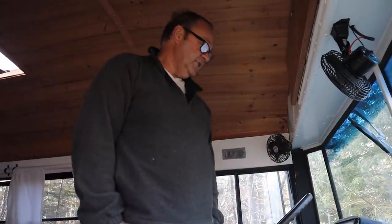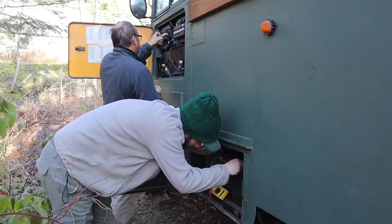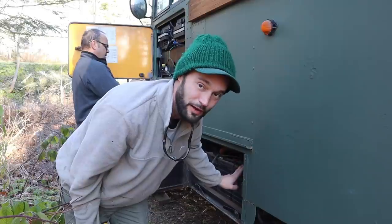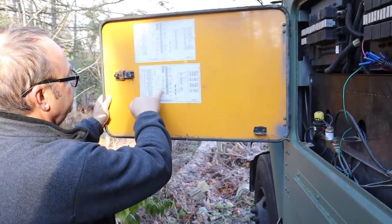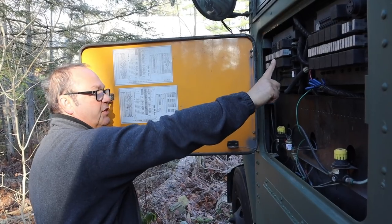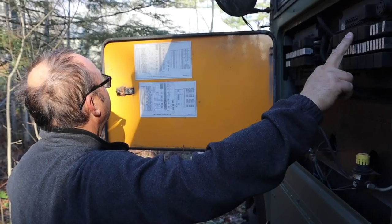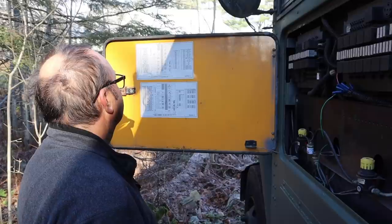It clicks. Let's start with number one. Found our first thing — I just tested the batteries and they're showing 11 volts. I don't think that's the issue but they definitely need to be charged. This is the fuse panel for the bus, and in panel board two there's the ignition relay. I just took the spare relay in one position and moved it to this position to see if by any chance that relay is no good. Let's get the batteries charged up first, then we'll check the relays, then we'll check the starter. Start with the basics, then move to the more complicated.